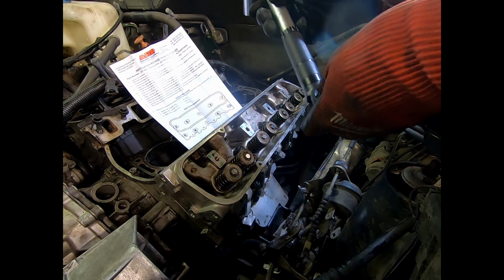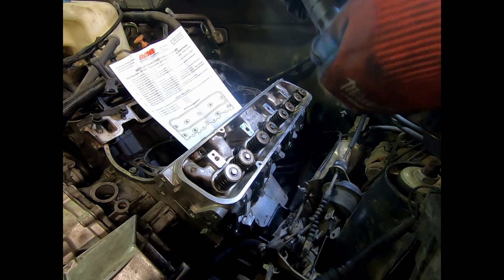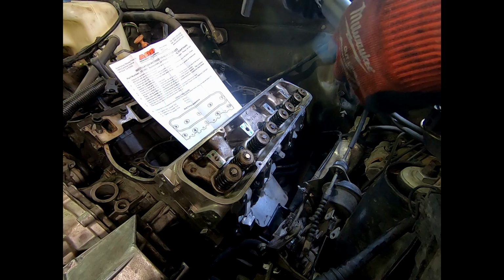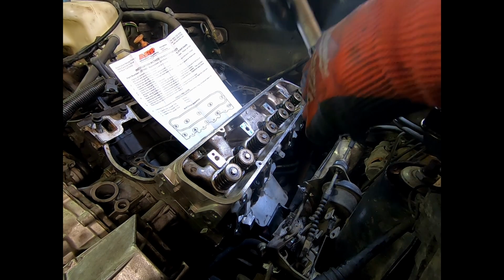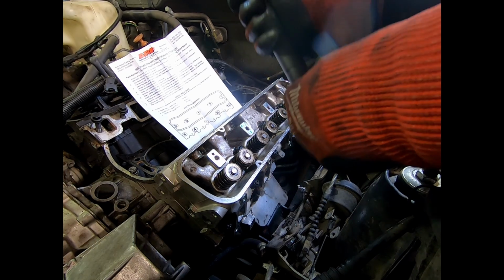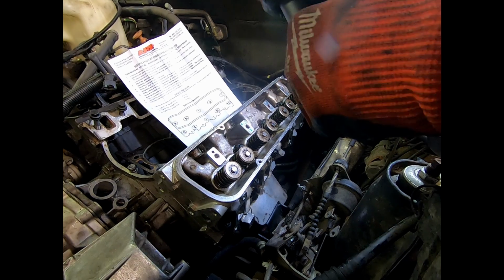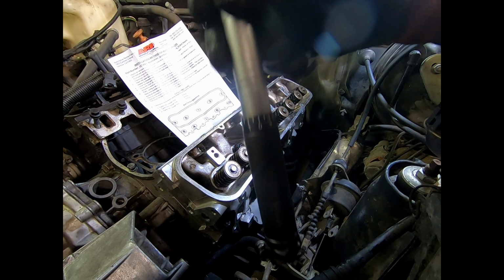So what we'll do, take our torque wrench, loosen that out, this is specific to mine, but general to many. Set our 0 here, I don't know if you can see that well. I'm going to spin that until it gets to 25 foot-pounds. Right on, 25 foot-pounds. Hold it in place, tighten the nut, just to verify, 25 foot-pounds.